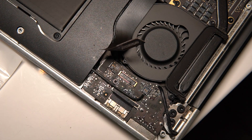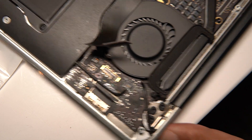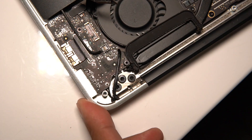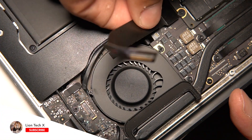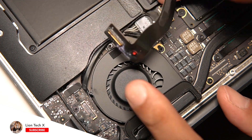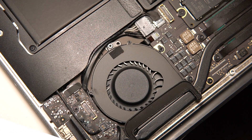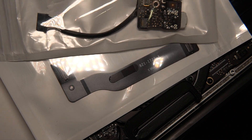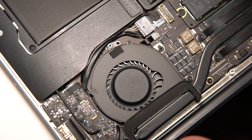What you're gonna do is pop off the backplate of the MacBook, then disconnect the battery right here by just pulling it out. After that, go ahead and take off this ribbon cable. Because it shows that red dot and you can see the corrosion — this cable is pretty much no good. I got a kit, I'll leave the link in the description below. My kit came with a cable so you didn't have to place two separate orders.